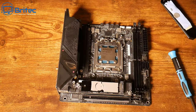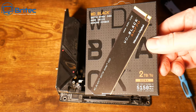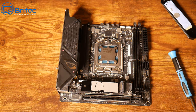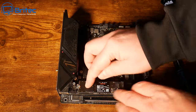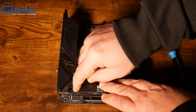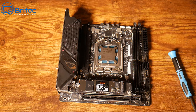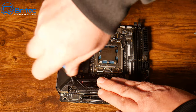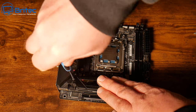Let's remove this little cover and we can now use our Western Digital Black SN770 - two terabytes on this one. It should be plenty for what we're going to be using here. We'll just put that into position and it doesn't need a screw because it has its own little catch which you can just pull over to lock it into position. Put the cover back on, make sure you remove the plastic from the thermal pad underneath that cover, then just screw it down and we're good to go.